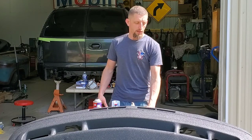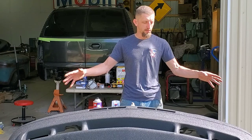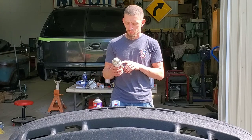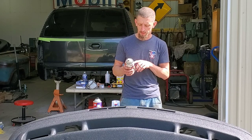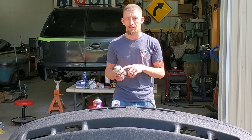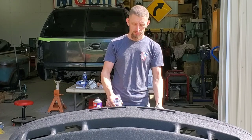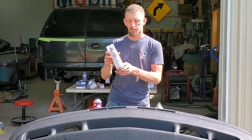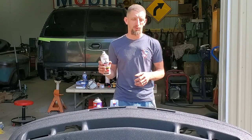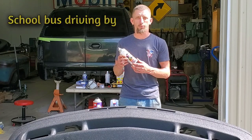So there it is. It looks beautiful. It's glimmering. I can't wait to put it on the truck. I will say that the drying time, it says dry to touch 30 minutes, dry to handle 1 hour, full cure 7 days, pot life 4 hours. Big difference from 4 days. So keep that in mind when you're doing your job. It still feels like there's a little bit of contents in this one, but this one was one that was giving me a little bit of problems.